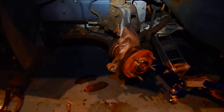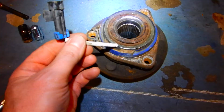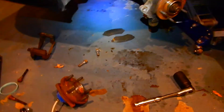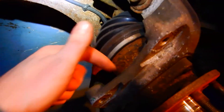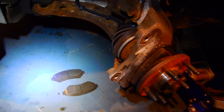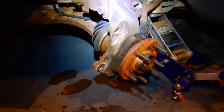The problem with these Impalas and Malibus as well is that this is the old one, so the ABS sensor is right here and it's built into the wheel hub. There are lots of vehicles out there that have the ABS sensor that pretty much screws in right here to sense wheel speed, held in by one screw — you can change it in about five minutes. But this one has an internal sensor and the only way to fix it is to change the hubs.